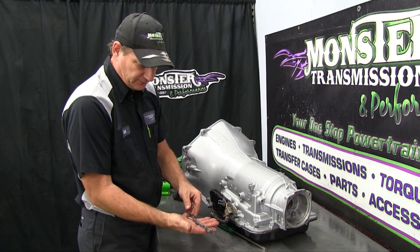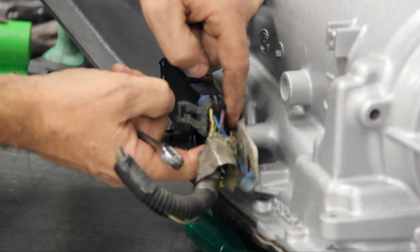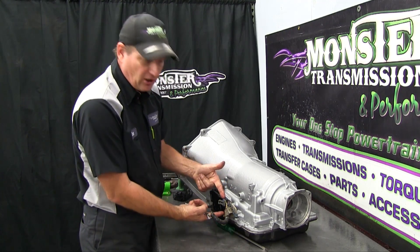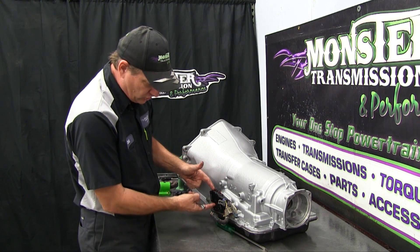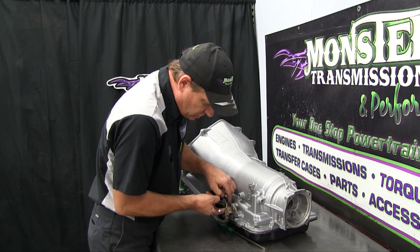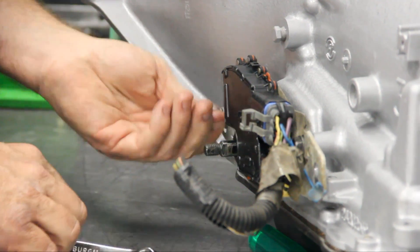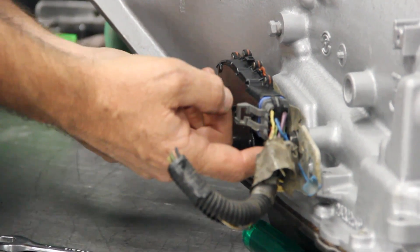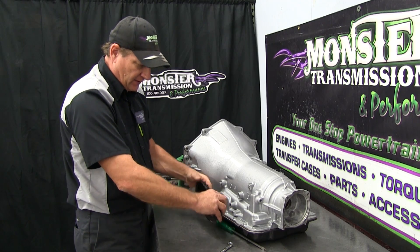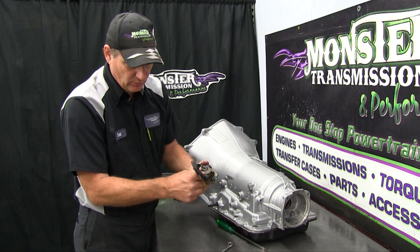Use a 13-millimeter wrench — you can actually wrench the bolt from behind. Once you get the bolt loose, you can simply turn that bolt to remove it from inside and still have the harness connected. That way you will not break your neutral switch. Once the bolt is loose enough, remove it from the front as well — 13-millimeter head. Remove both bolts off the case, then slide it down the shaft to remove it. You can leave the bolt inside the switch so you don't have to remove the harness.